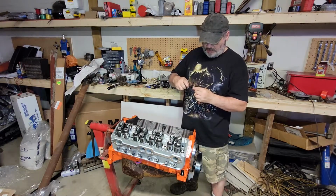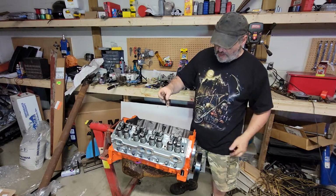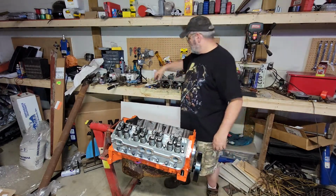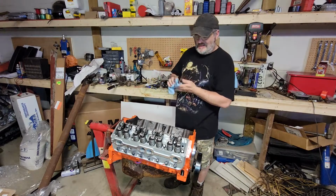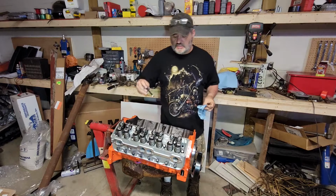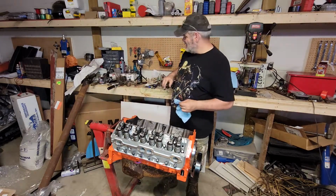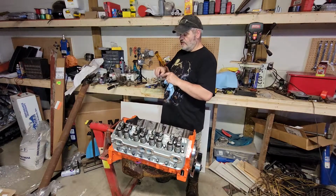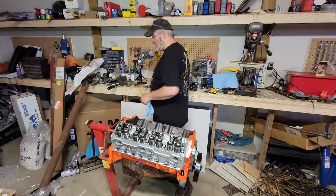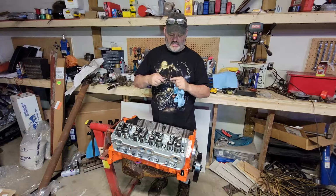You don't need a whole lot of sealant. You really don't. Like I've seen guys just pour that stuff on there. Well, most of your sealant's just going to end up down inside your water jacket and eventually into your cooling system. And to put it into perspective, I've slammed these engines together, lots of them, without any sealant at all, and never, not once, have I ever had a head bolt leaking into my cylinder. Would I recommend that? No, but you know, there comes a time when things just got to be done.